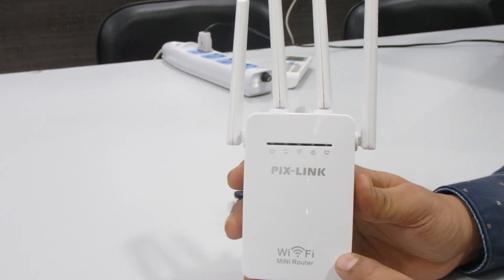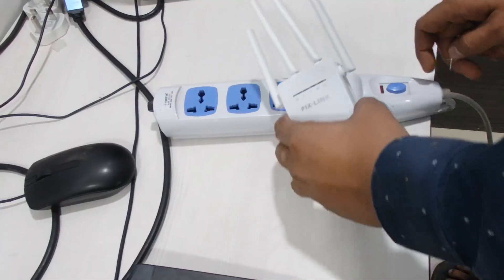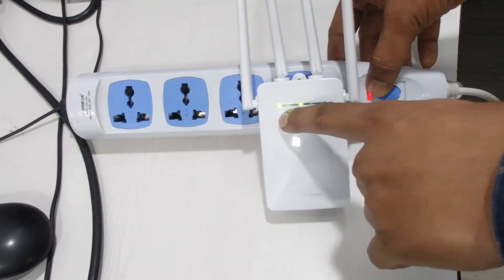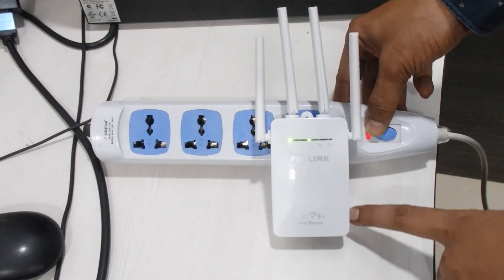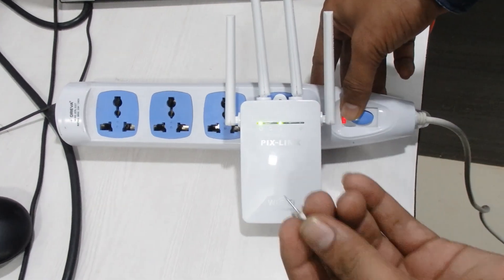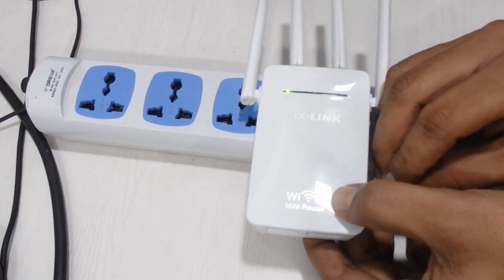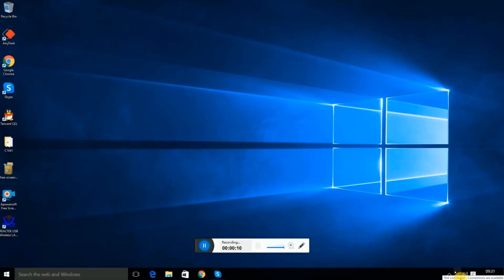Now we are going to test this product. Connect it to the UK power socket and turn it on. You can see two LEDs — the power LED and the middle Wi-Fi LED blinking. When setting up for the first time, make sure to reset the repeater using a paper pin. Press and hold for five to ten seconds to reset.